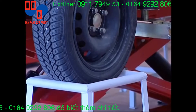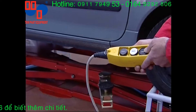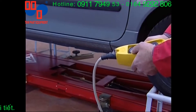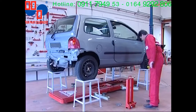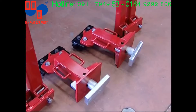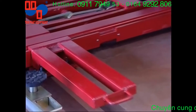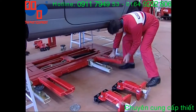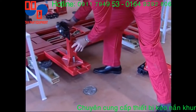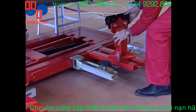The vehicle to be repaired is first positioned on four support stands using the lift. The operator hooks on the four clamp fittings. The four vehicle fixing clamps are attached to these fittings. The clamps are adjustable to provide the best fit with the shape of the vehicle's sills.